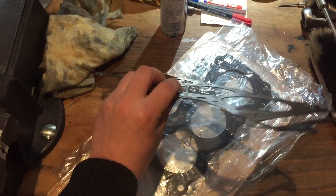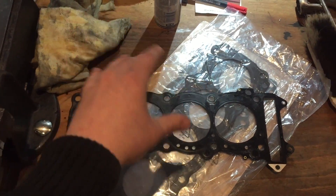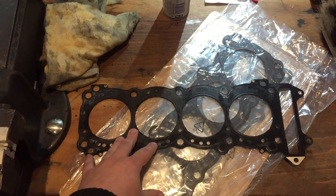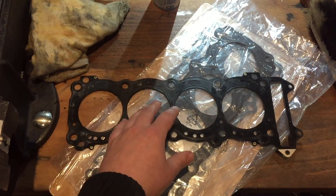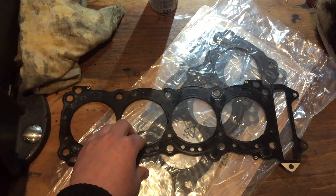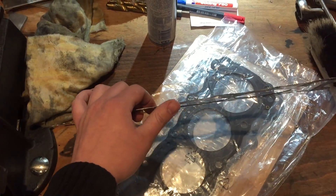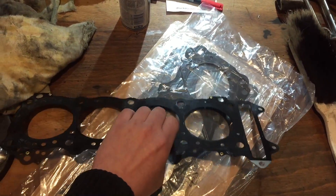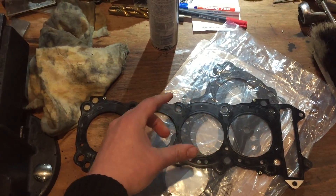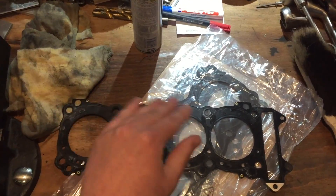This matters — like with my bike, if you have a cylinder head that is fly-cut, or you have cylinders that are fly-cut, all of the spaces are narrower, closer to each other. A 0.2mm difference can make a huge impact on the bike. What I noticed is this cylinder head I have on the bike is fly-cut — it's 0.2mm shorter. So with this 3-ply gasket, which is another 0.2mm thinner than the original one, I had a lot of problems getting the valve clearances right, because if I got too tight with the clearance, the valve would open too much and then the piston would start to touch the valve. You can see how close this is altogether.